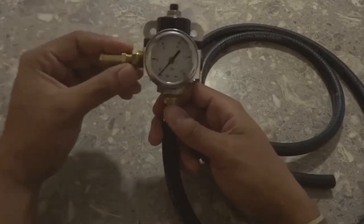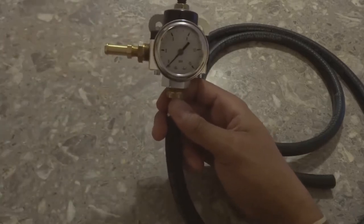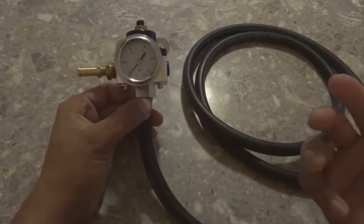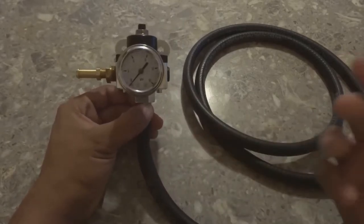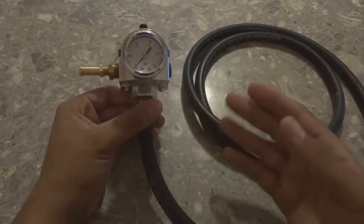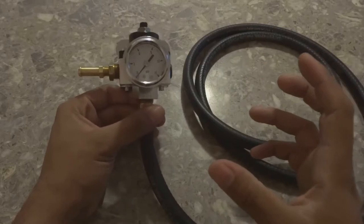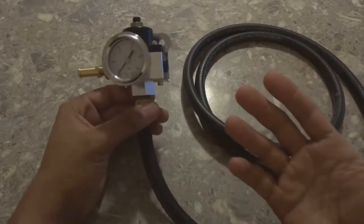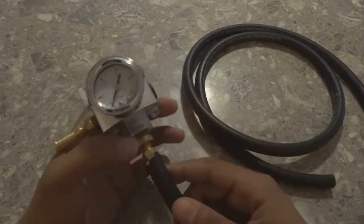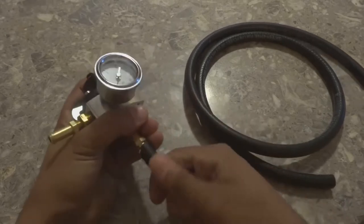You're going to put hose onto this side, clamp it down, and send it to the carburetor and clamp it down again. And that is how you basically do that EFI to carbureted swap without having to go in your tank and change that pump to the low pressure carbureted pump. You know, it's really easy and very inexpensive. I'll put the link to this in the description as well, but that's basically how I'm going to do it.